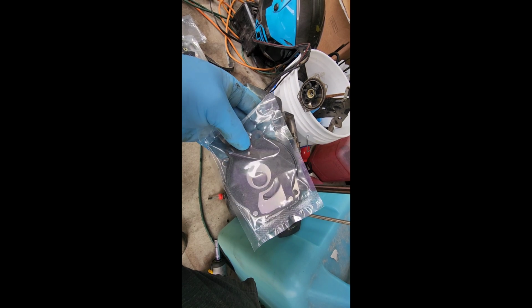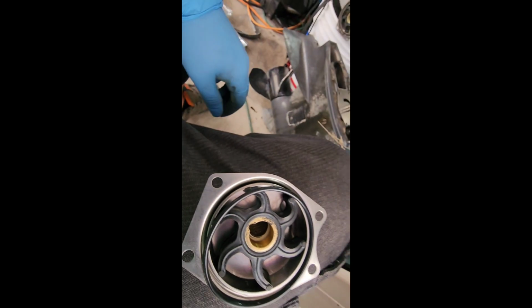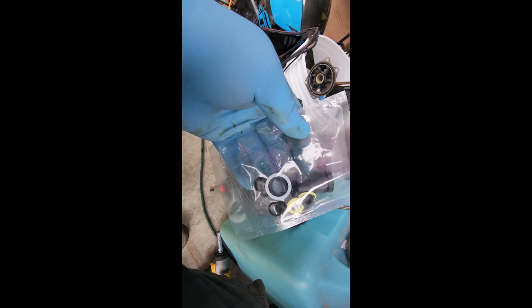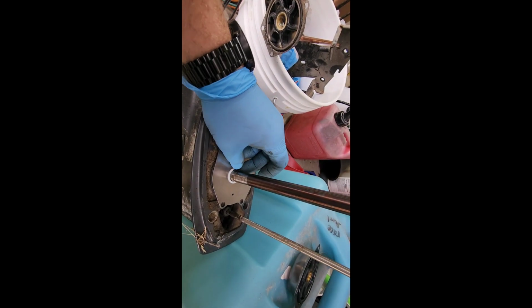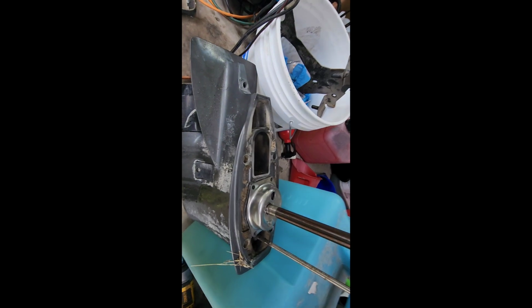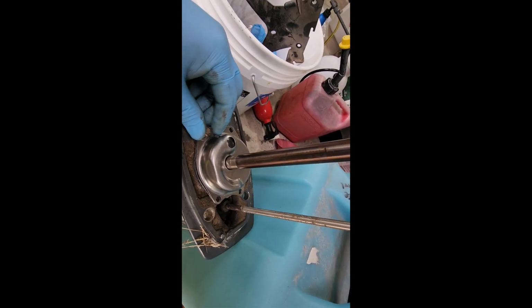With that off, you're going to grab your new faceplate, gasket, and O-ring. Gasket and faceplate only go on one way. So then you're going to grab that O-ring, put it on there, right like that. I'm going to set that off to the side. Your little kit has a second nylon washer that goes right there. And now your little keyway can sit there. Now it's time for this. Now that you got that on there, we're going to go ahead and start a couple of these.